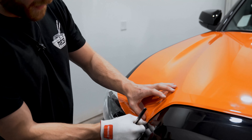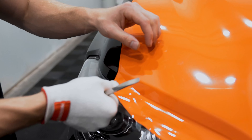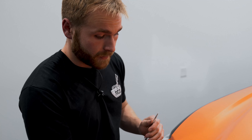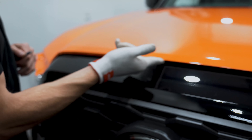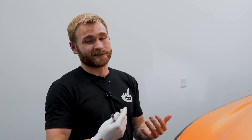With the hood popped, go back and make sure all of these corners have proper stretch — sometimes when it pops up the film will come off the corner, so re-stretch it back to how it was. Use your glove and slowly roll this edge, working back and forth in small increments. You want to start at your corners — those are the most important part. Any bunching you may have on the corners, push to your straight edges. That is a very common mistake: people leave corners for last because they're difficult, and they bunch all the film there, which will cause creasing.